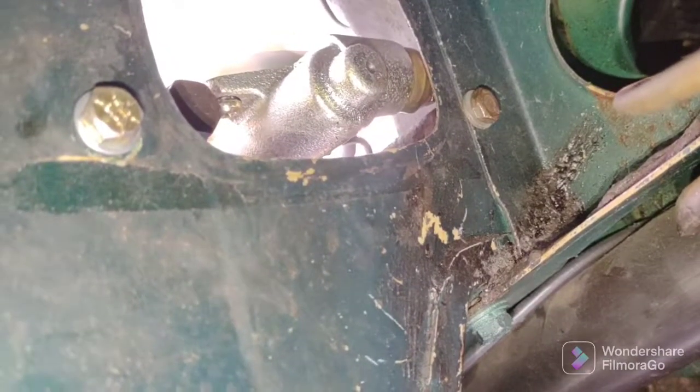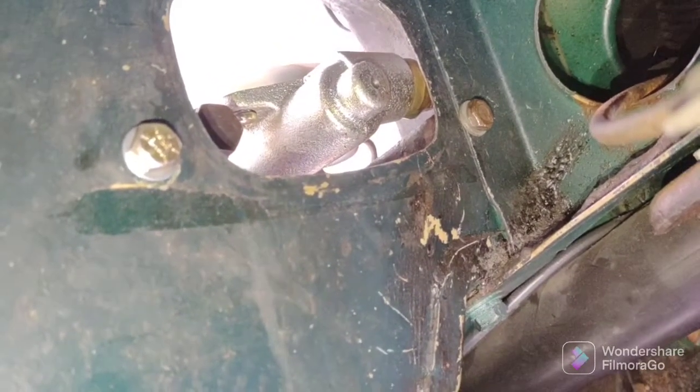What I did was thread and screw down the two bolts from inside the passenger compartment - not fully tightened so I could have play in the bracket to line up the other holes for the engine compartment bolts. They're almost tight, but there's a little play so I can move the master cylinder bracket around and line up all the holes. Now I'm going to get some washers and put the four bolts to secure the master cylinder bracket down for good.